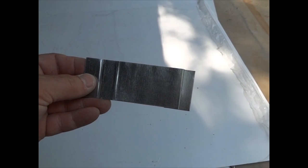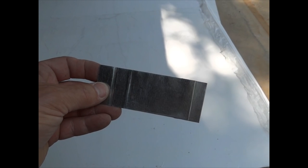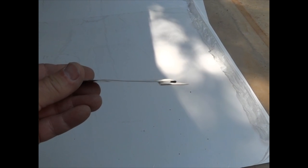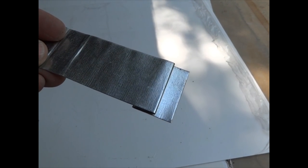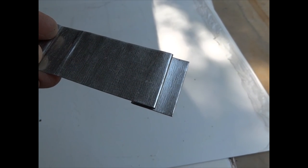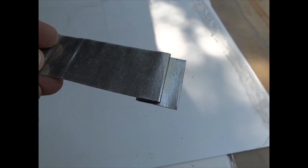Here's a little better depiction of what that S-seam is like — this is just a handmade sample I made. If I turn it sideways, see how that metal is bent in an S pattern. The bottom part that sticks out below the S is where the screws will go. I'll use that flange with screws to attach it to the aluminum framing of the trailer to hold these panels in place.